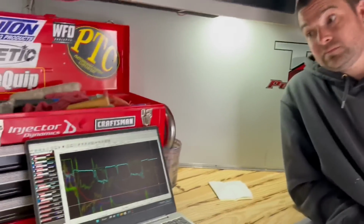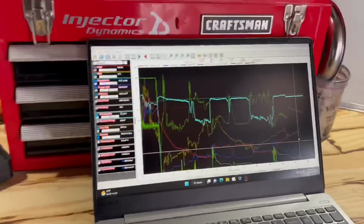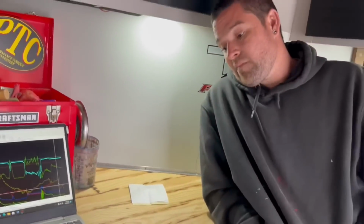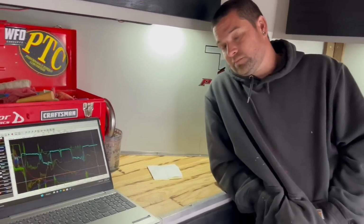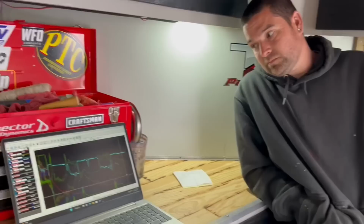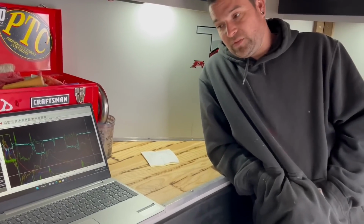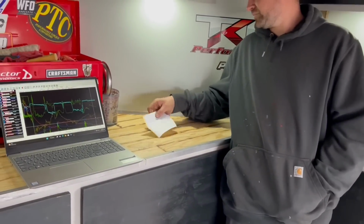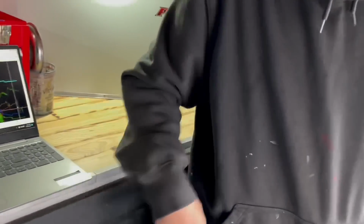So we decided best to just make one pass, since we know it was safe, nothing hurt. Because at Holley it was still nice and fat, it never deviated from target. So I think it's not a problem, but that's not something that we want to continue to happen. Yeah. We want the fuel pressure to be rock solid. Fuel pressure should be stable. So he's going to research, make some phone calls, and see if we can figure out if just one pump, maybe the external, is enough. Maybe it's not.